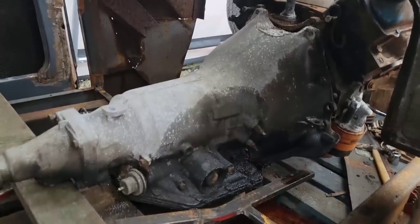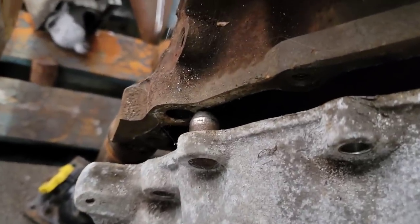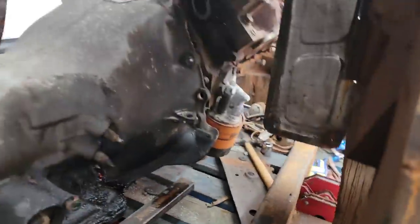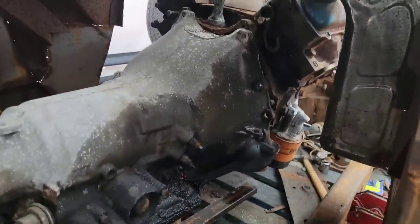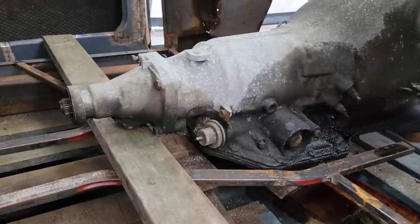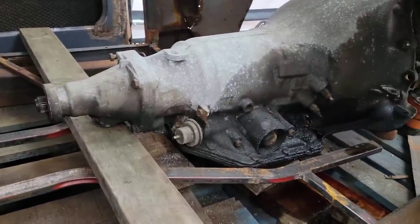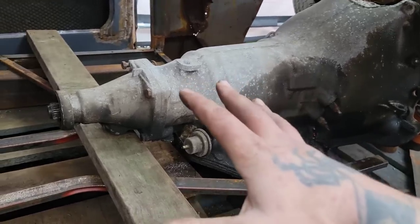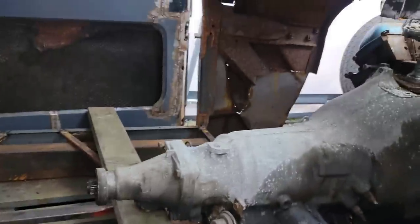So, no video of prying it loose because I'll show you what happened. We got a dowel in the motor there. A dowel in the transmission here. That was not supposed to come out. It's supposed to be pressed into the motor, and it did not want to stay. So currently, the plan is to get the entire transmission up on some 2x4s up on the sills here. I'll wiggle it back, work boards underneath until I can get it all the way up on a couple of 2x4s. Once they're on 2x4s, we can slide it right out the door opening, lift it down to the ground.